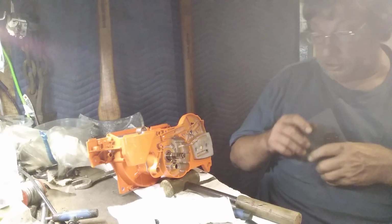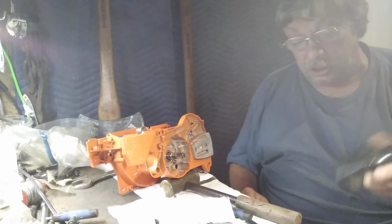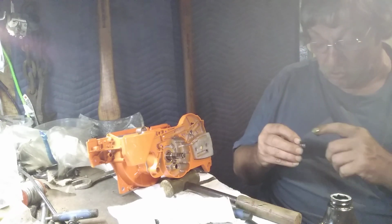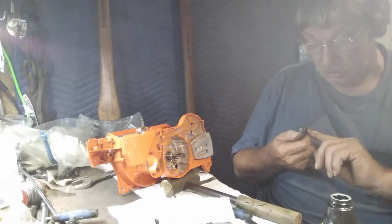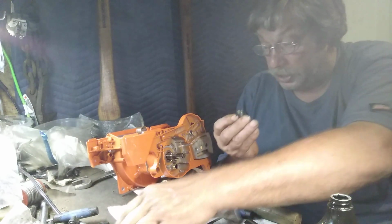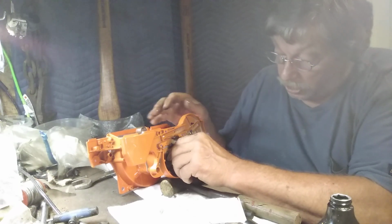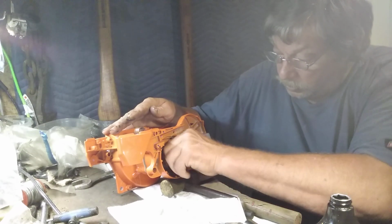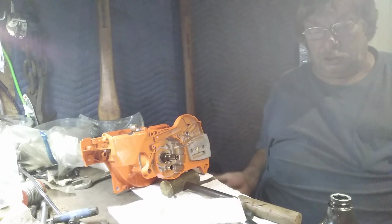Okay, now that crank is stupid clean right now. I didn't want any oil on that. So what I'm doing right now, I'm putting just a little dribble of oil on this, and I'm making sure I don't get it. If I would have tipped that the other way, that'd run right down that silicone. Okay, this goes in your seal. You rotate that in your seal. That's all you do. Just give her a little push.